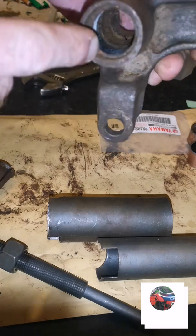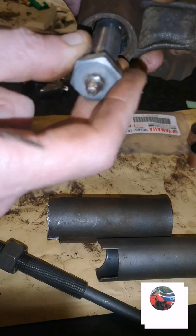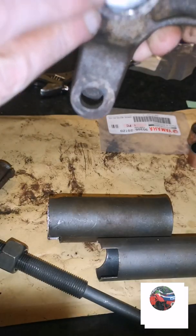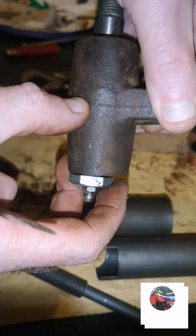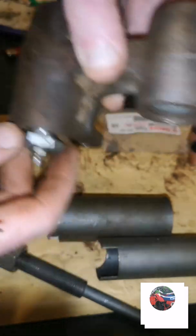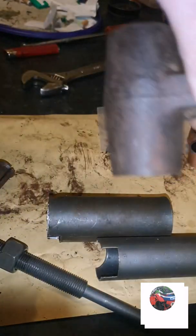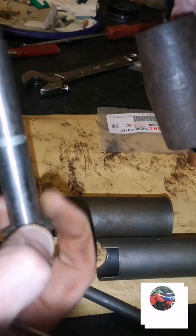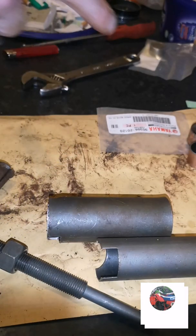on these two copper bushes in here has to fit through there. So when you grease your swinging arm up by there, the grease is going through the middle and it's missing this brass spacer and that brass spacer. Same with the other bolt. There's another bolt what comes up here what fits on the swinging arm. That's just the same. That's got two of these copper spacers in. We'll be doing them next after I've done this.